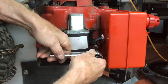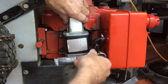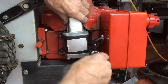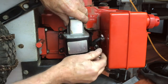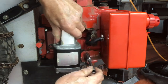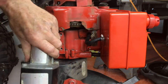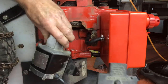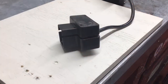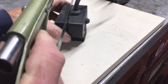I'm going to remove the complete starter and switch — it will be easier to have a closer look at it on the bench. There are three bolts that hold the starter on. The bolt I'm removing connects a bracket to secure the bottom of the fuel tank and the starter. I've already removed the two bolts on the left side. The starter and control switch are sold as one unit, which is what prompted me to try the repair, as the wiring looked in great condition.